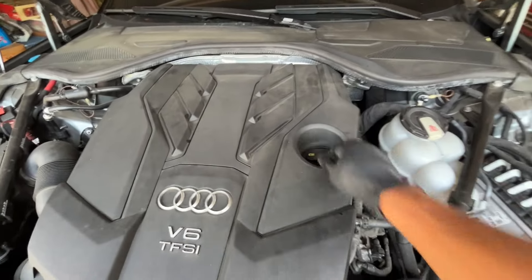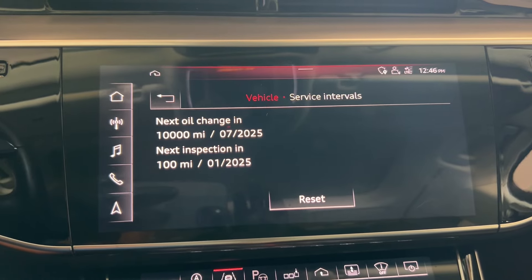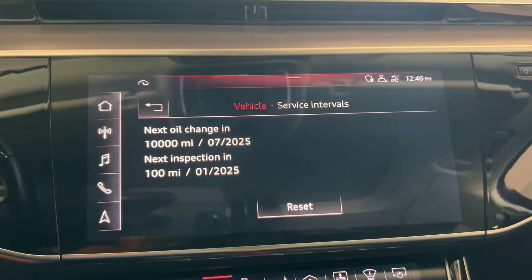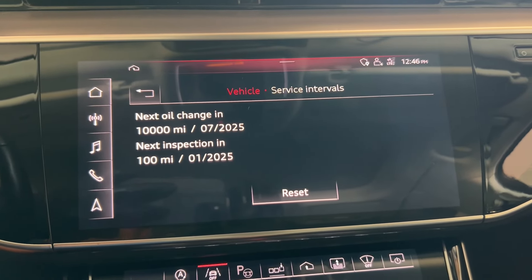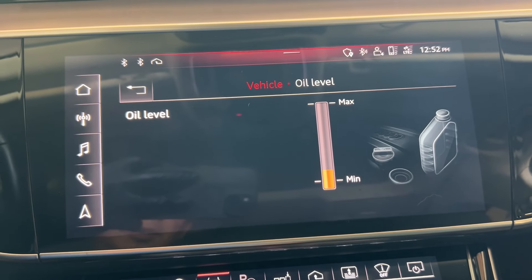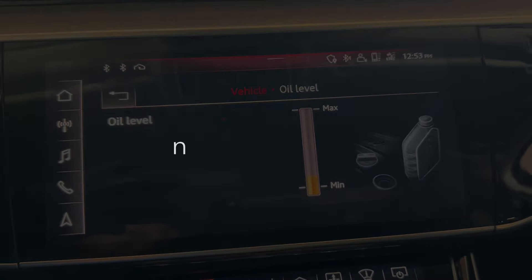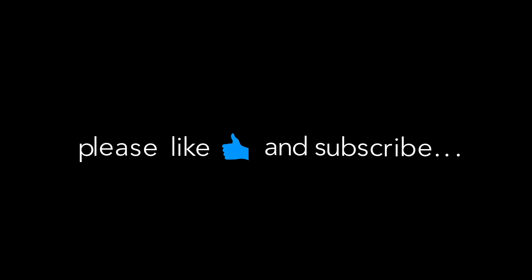Put everything back and top up the coolant a little bit. We reset the service interval — it's going to be 10,000 miles next July, because we drive 10,000 miles a year. After putting in 7 quarts, it's still a little bit over minimum, so we need maybe another 0.8 quarts to fill it up. Let's get started — thank you.